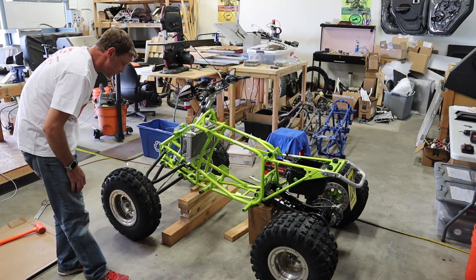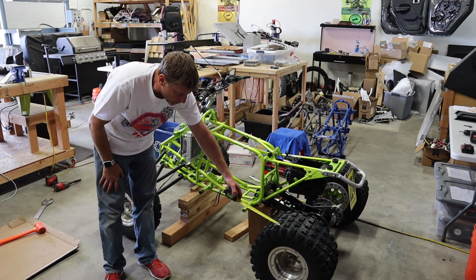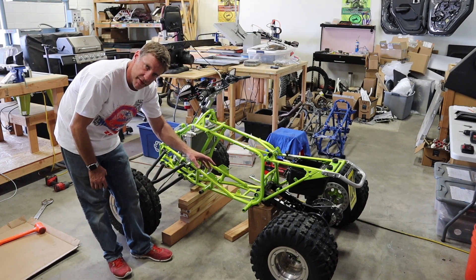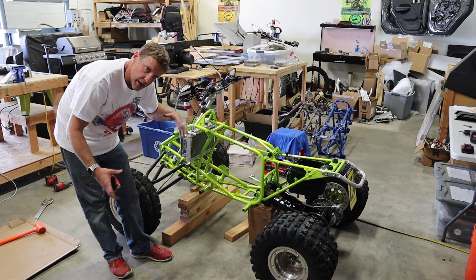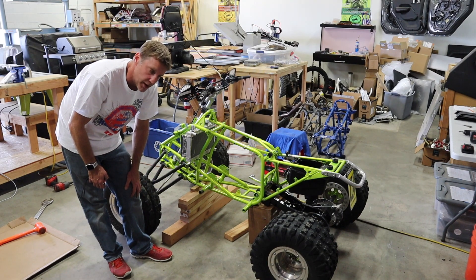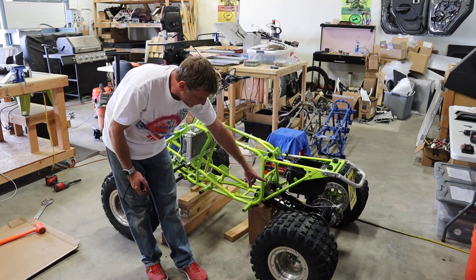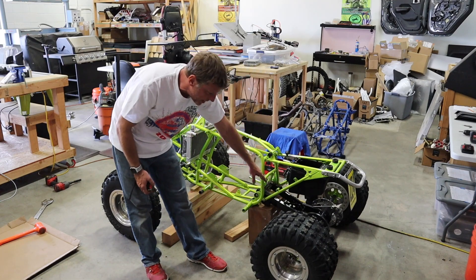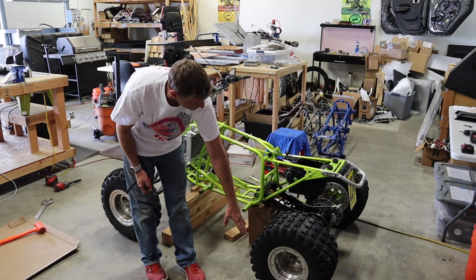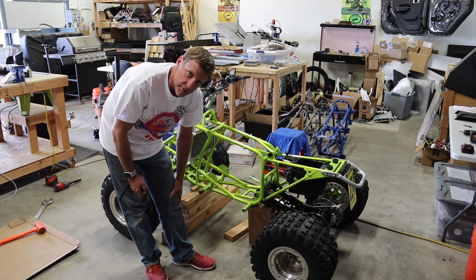On the rear — and also, you want to make sure your tire setup is what you're going to run, or at least the same size. These are 21s. These rears, OBORs, are supposed to be 20, but they actually measure 19. I'll discuss tires in a later video, but I think they did that because this is a heavier tire — by making it a smaller diameter, it compensates for the weight at the same gearing. If you run a GBC Groundbuster 3, it's a very light tire but a true 21 inch. So if I put a true 20 on this, I'm actually going to lose almost a half inch, because going from a 19 to a 20 raises the swingarm a half inch to the dead center of the rear.